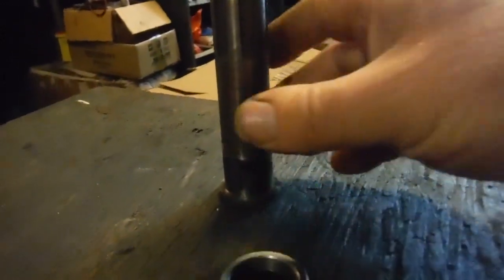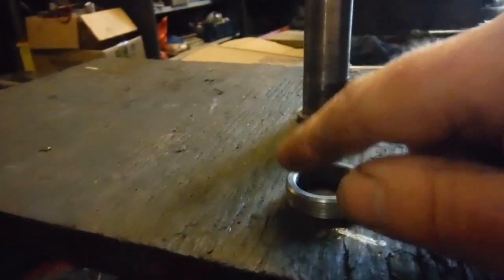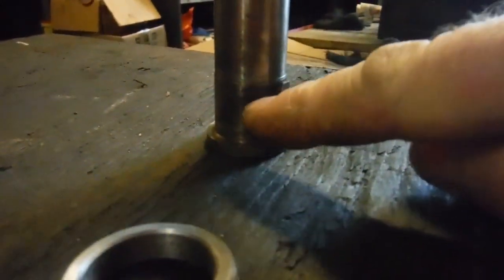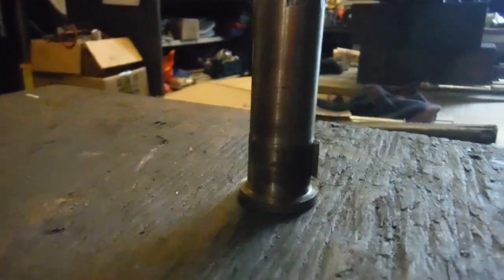While we've got it, I thought I'd discuss a bit more about this spacer and what it does and how it works, because I have actually stripped some Bullet engines where it has been missing — surprise, surprise. The drive-side main shaft is a press fit through the center of the flywheel, and there's a keyway with a key so that it doesn't just slip. It's keyed and held firm to provide drive to the clutch when the engine's running. It's very important that this flange on the end of the main shaft is pulled tightly into the face of the flywheel.